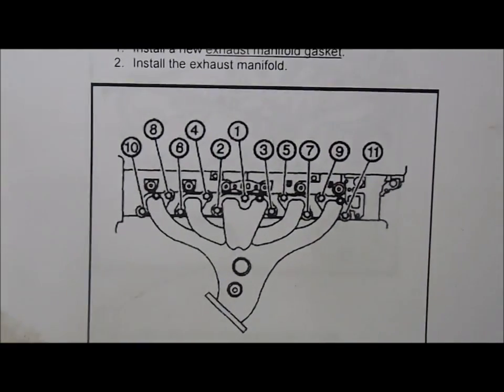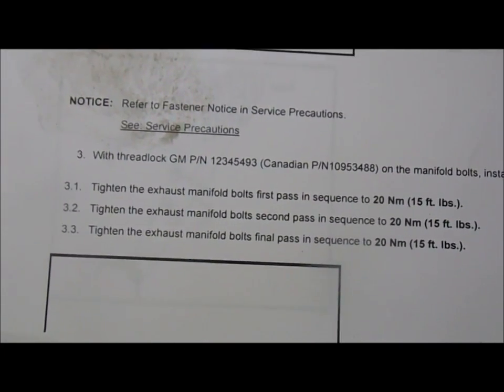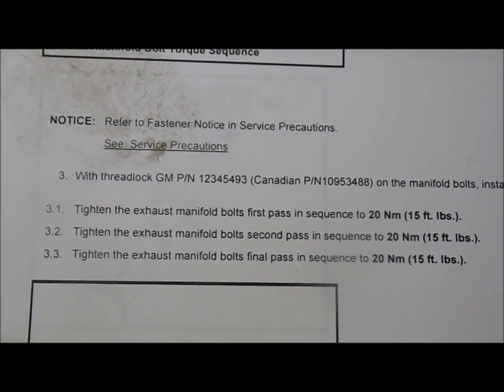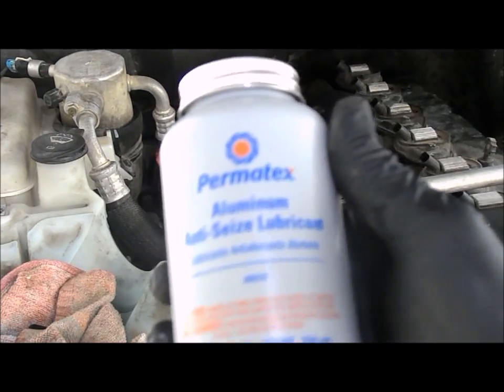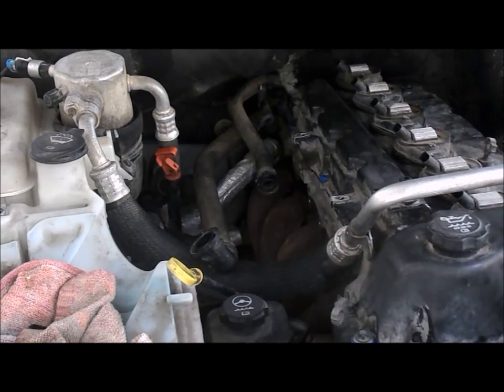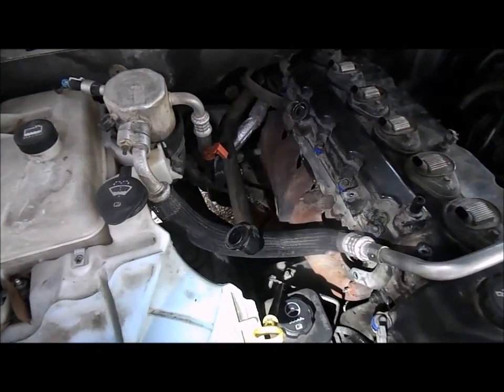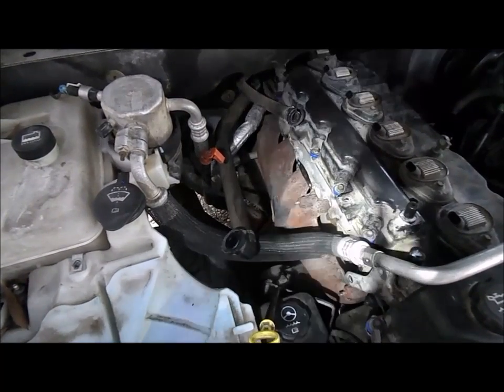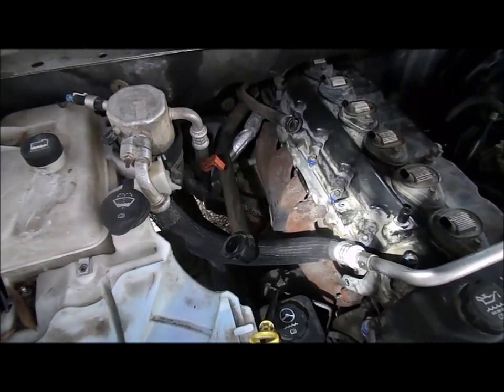To correct myself on the exhaust manifold: here's the bolt pattern. We're going to put in the new gasket and tighten according to the pattern. The instructions say to do three passes up to 20 Newton-meters or 15 foot-pounds - so three passes on the bolt pattern. I also got anti-seize to apply to the bolts as called for. The exhaust manifold is in. It calls to put the shield on first, but I'm going to connect the tailpipe first since it's easier to see the gasket that way.